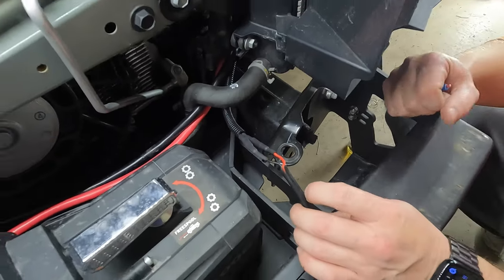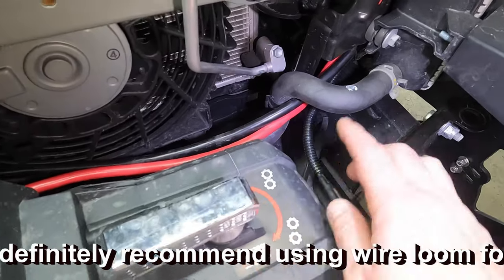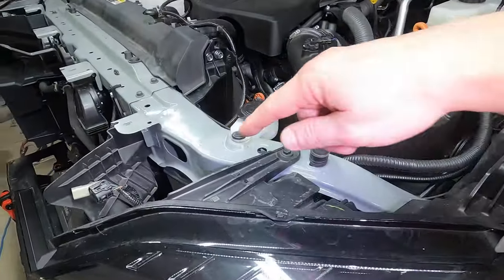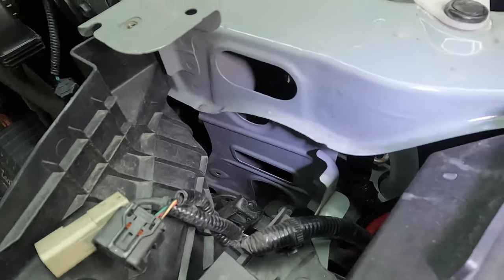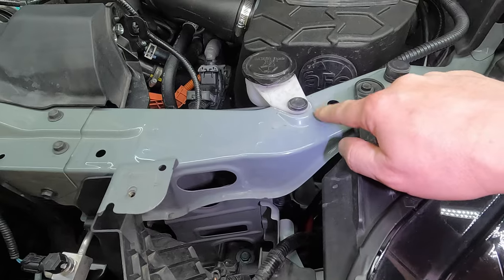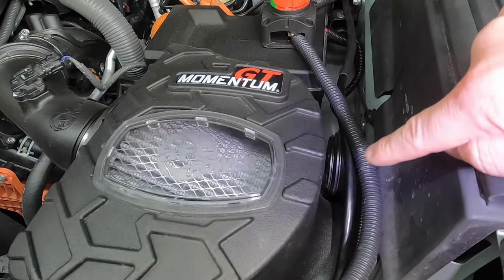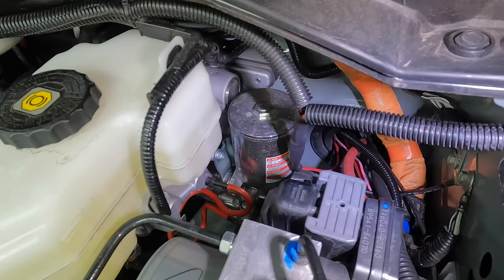You can see we have the wire coming off the light, our connections, and the wire loom right there. If you saw my winch install video, we basically ran the cable the same exact way — there's a channel where you can feed it. You can see my thick cables from the winch coming up through here. Up top it's basically following a channel that comes up and pops out underneath this part of the engine bay. It comes along in here, pops right out by our intakes. The smaller wire loom runs all along, tucked in and secured, straight back to the grommet we used to get into the engine bay.